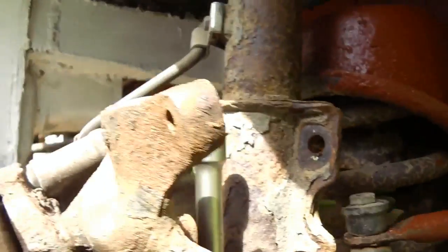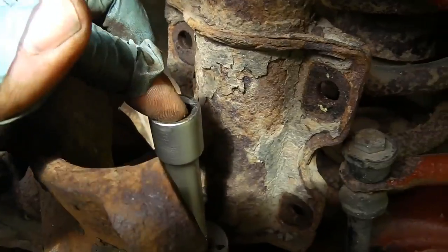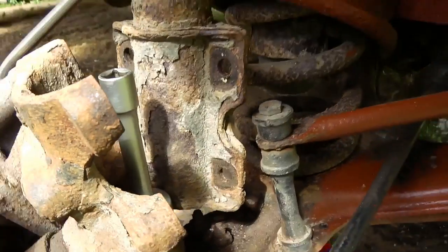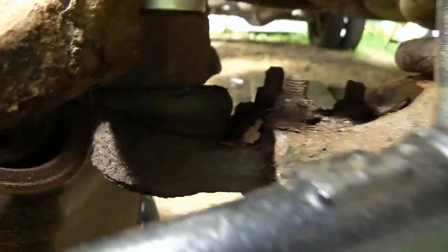In preparation, I soaked these bottom three bolts and I've removed the strut bolts from the hub to give me a bit of room to get a socket on the top nuts on top of the ball joint, just to crack that off and make life a bit easier. Then I'm just cleaning all this up - a bit of a rub down to get rid of all the flaky rust.